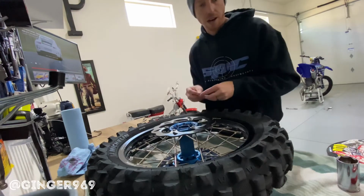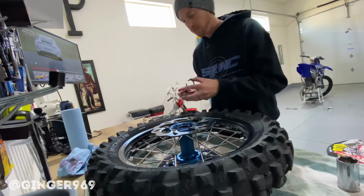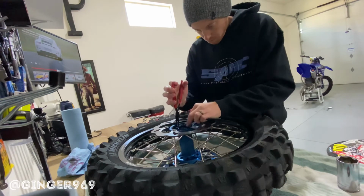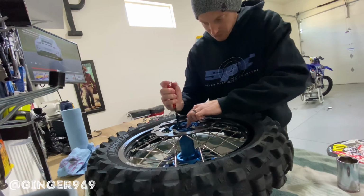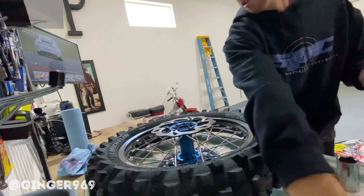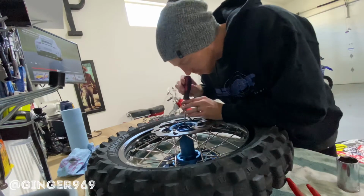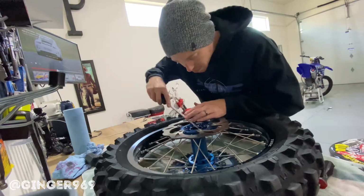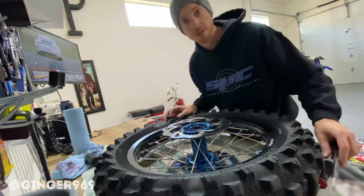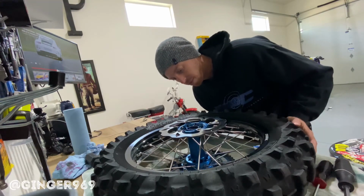And part of the reason I have to replace my wheel bearings usually, not this one per se, this one seems like it got a little bit off center or something broke on it. But usually it's due to pressure washing the bike often. Highly suggest getting a pair of these. They help a lot. And you want to make sure that the pin pops into place. We got the circlip in. Basically, it just had to readjust the wheel spacer inside and then just seat it again, and it worked just fine. So maybe something you'll have to do too.